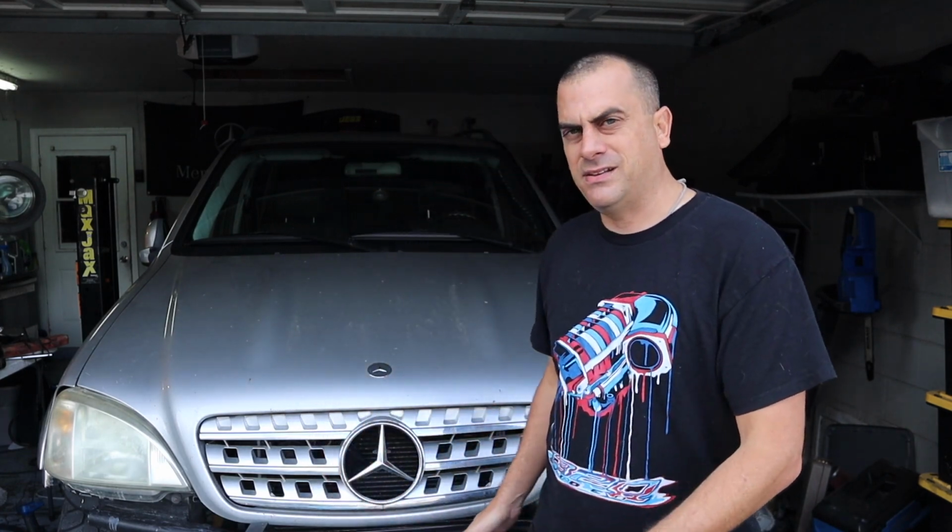So what we did on this car, we lifted it in a few videos with basically the rear blocks. Those little blocks, we did that in the rear, and then we indexed the torsion bars just a little bit, and then we manipulated the torsion by going up and down with the bolt to raise it up. And I put on some mud tires, nothing really too big. They're roughly 31s. And then I got rid of the front bumpers, as you could maybe not see in this view, but I'll show you around the car. And we did a couple other things like that.